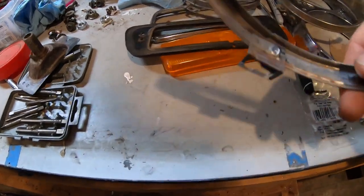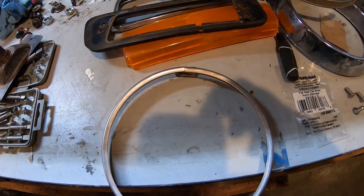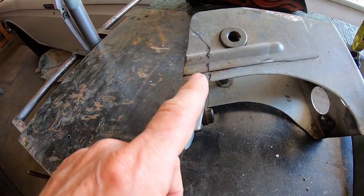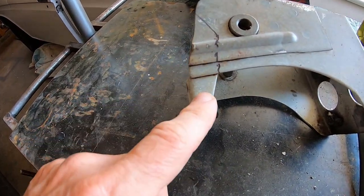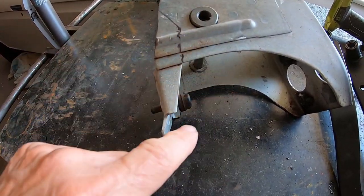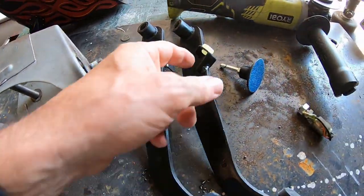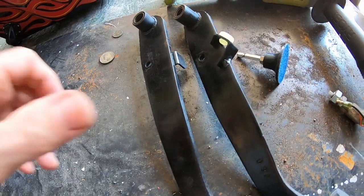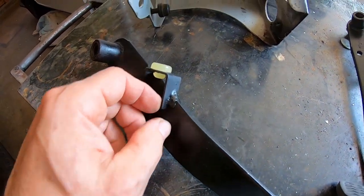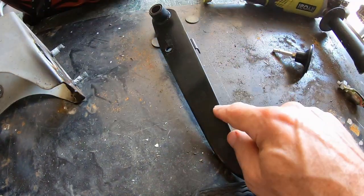I just put a rivet in there and smashed it afterwards — that's fixed. Here's the pedal assembly — my idea is I could take about an inch out of this. I don't need all this steel and it's in the way since I have electric steering. I'm going to cut this straight off, then weld it back on an inch or two lower. I'll have to move this little tab. I just painted these pedals, so now I have to ruin my paint job. I need to move that thing down the same distance.